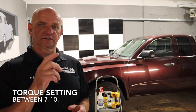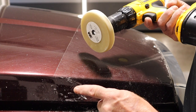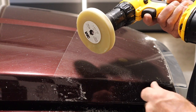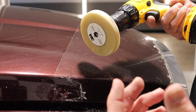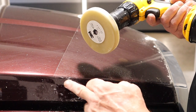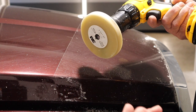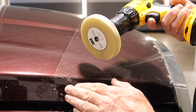You want that wheel to spin back onto the clear bra. As it peels back there will be some adhesive residue left behind on the paint. With that adhesive residue, we'll be taking it off with an adhesive remover — we use a product called CalSolve from Car Beauty Pro. You can do a very similar thing with Goof Off or Goo Gone, or any sticky label remover type adhesive remover.